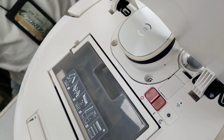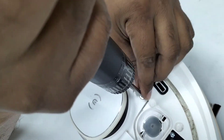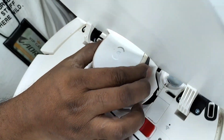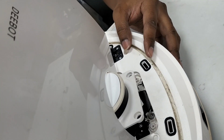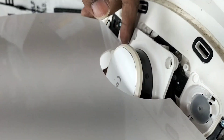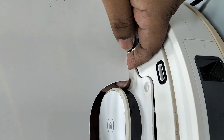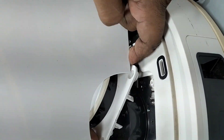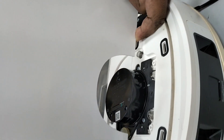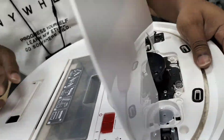No need to open any other screws - just only these four screws. Lift up this cover and take it out like that. It's actually stuck from here, so put your finger here to slightly pull like that. You can see from here it will come out - just take it out like that. Now the cover is in hand.